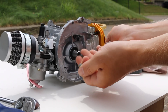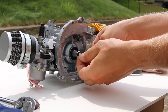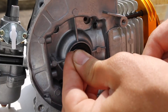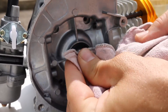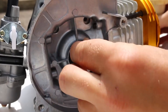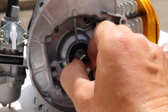I'm going to be retarding the timing. They also say the stock key just works best for some engines. I'm new to this — I haven't done a rocket key install before — so I'm going to play around with it and go to the left. Now we're ready to reinstall the flywheel. Before we do that, I'm going to take the key out and do what they recommend: wipe off the end of the crankshaft and apply a little bit of grease with the key in it.